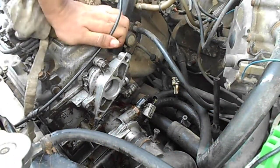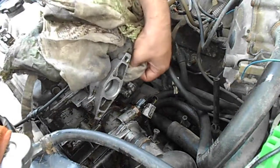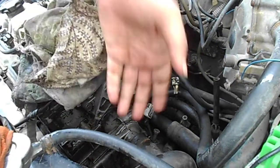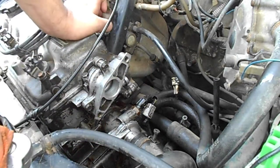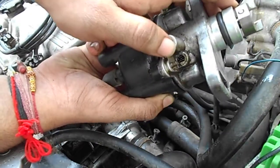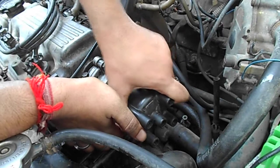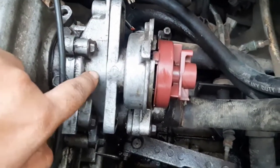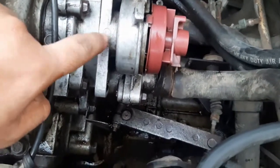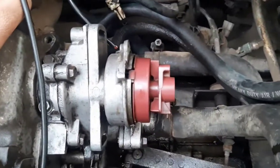That's all about putting the gasket back. I will see if there is any leakage again — if there is, I will go to the garage and check if the engine block itself is cracked. Then we'll see what to do after that. Let's put everything back and I will meet you then. There is this grill-like structure which is going to face downward and attach like that. You have to remove this cover to put it back because it controls the inside part — you can see the U-shaped part which has to be lined with the engine shaft. To do that you have to rotate it, and with the cover on you can't do that, so remove it — just two small bolts.